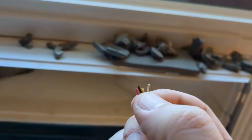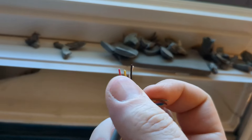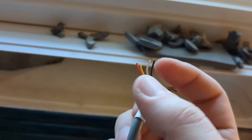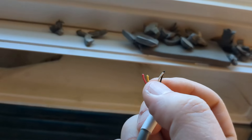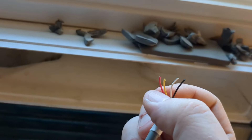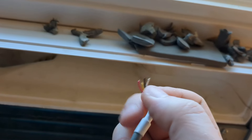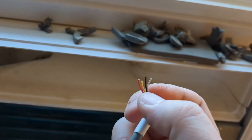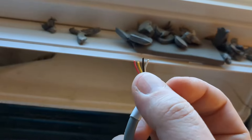We're going to pull back some of the insulation and tie all four of these wires together. Just get a pair of wire cutters, scissors, or a knife and gently remove the insulation — probably a good thumb's length. Then twist them together and wrap in some electrical tape or use a wire nut, whatever you have on hand.